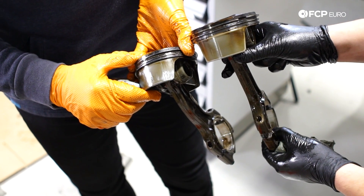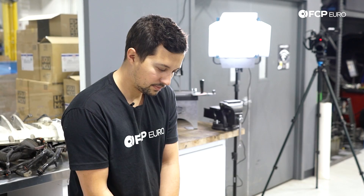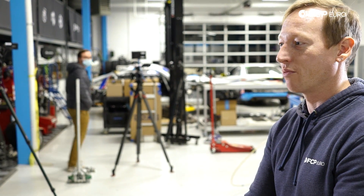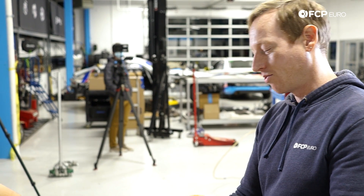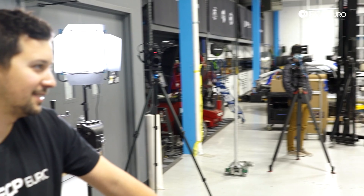It's like a domino effect. Engines act as an air pump. Air technically acts as a fluid. However, water, which is obviously a liquid and a fluid, is significantly more dense than air — you can breathe air, you can't breathe underwater. So when you take your engine and you try to make it do that same thing, a lot of stuff ends up unhappy. Every once in a while you can actually get away with just a bent rod and rebuild it, but you ingested so much water into this and it got through every single bit of the engine. This is truly fantastic carnage — that's a smoking gun. This is what I was hoping to find.